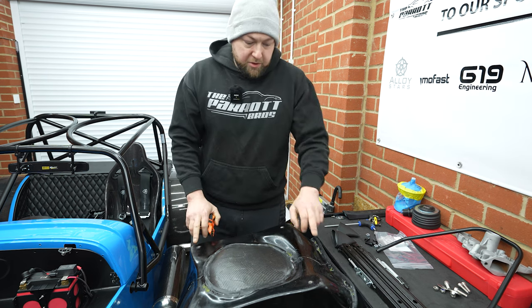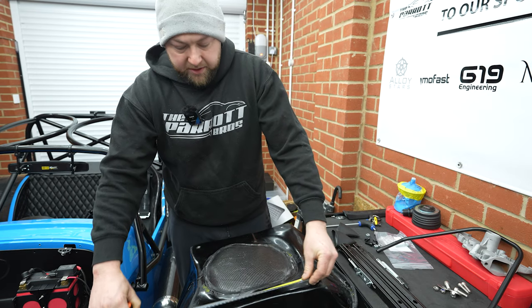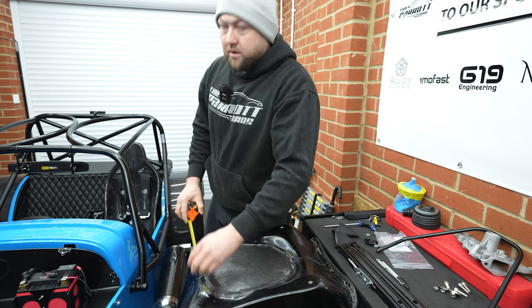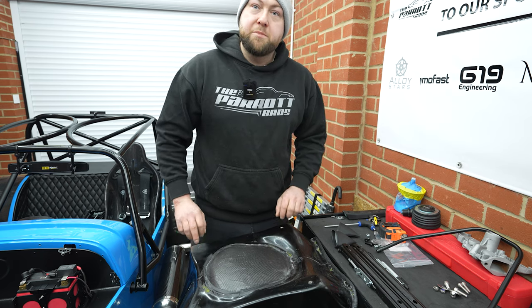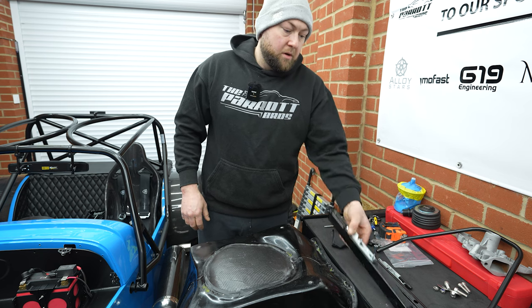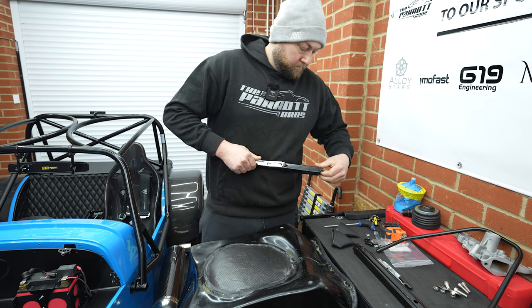When you buy runners, you have to look at the mounting measurements, which is like 310 and like 315. That's for selecting the runners you're going to be using. You don't have to do runners. You can go fixed position if you're the only person that's going to be driving it. But on track days you may sit slightly differently to, say, a road trip or some motorway miles.